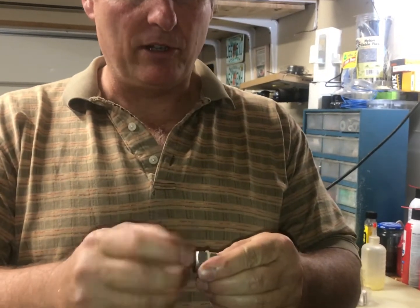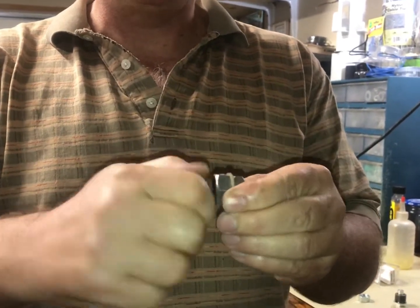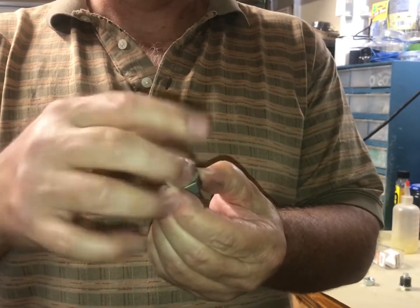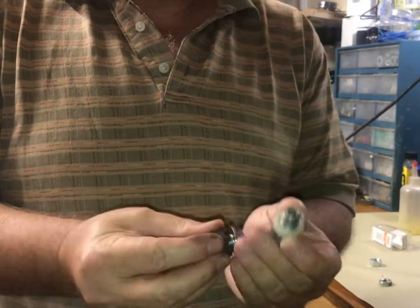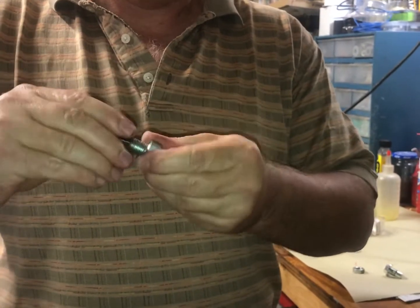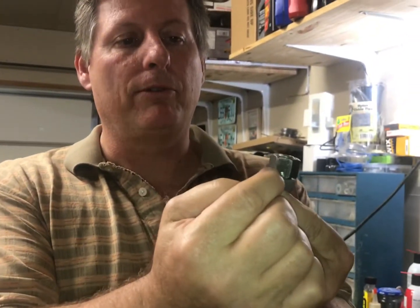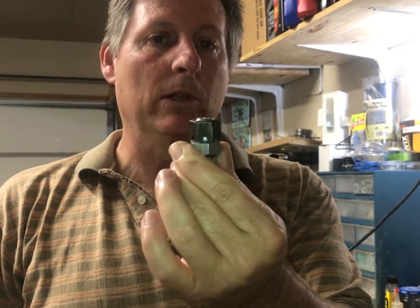Getting back to the motor-mite — when it's installed in the pan this becomes your drain plug, but you have this tiny little hole with an O-ring and it seems like you have to replace the O-ring every time. You can't tighten them up real tight because you'll split the O-ring and they'll leak. If you don't have welding skills, you could take a castle nut, cross-drill the shank, and install it that way — you'll still drain most of the fluid. You could just come in and drill through in a couple of spots; you don't want to weaken it too much.